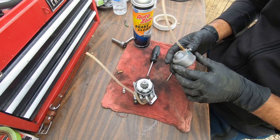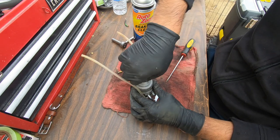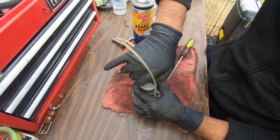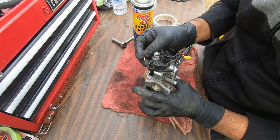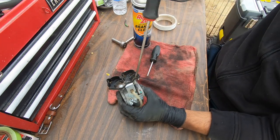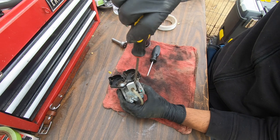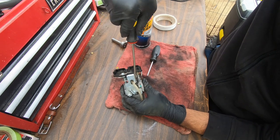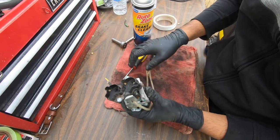Both are good. Next I'm gonna insert this — I should have taken note of which way that was pointing, but I'll leave it slightly loose and when I put it back in the generator I'll snug it up all the way. Don't forget to tighten it or you're gonna flood everywhere. Last, insert the idle jet like that — with lots of patience insert it and tighten it all the way back down. It's all the way in — now we're ready.